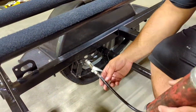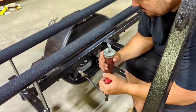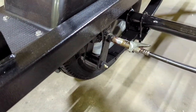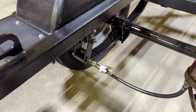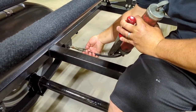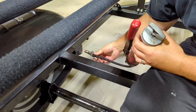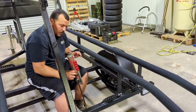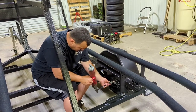These are easy — just two pumps per fitting. You can see the grease already pushing out. At 10,000 miles, you just want to replace the grease in here. Go to the next one, make sure it's locked in, and give it two pumps. This fills the grease around the bolt, which eliminates a lot of squeaking from your leaf springs and makes the ride smoother. Do all three bolts, two pumps each, then switch to the other side and repeat — two bolts in back, one in front, two pumps each.